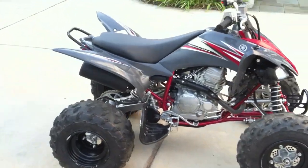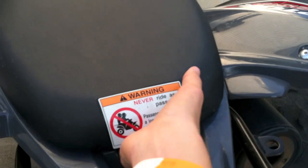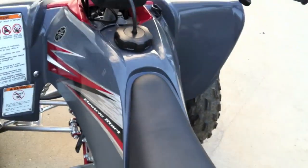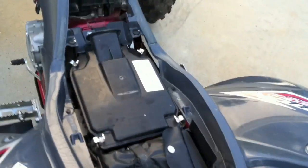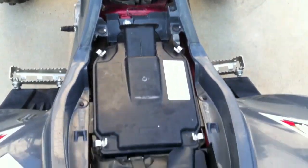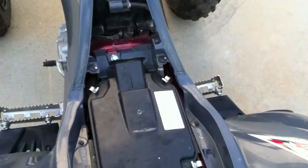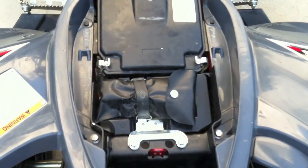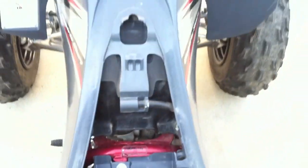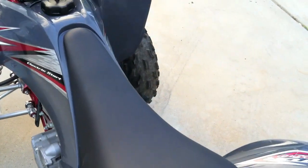Here it is, and it's really user-friendly. I was looking at this right here for the air box — you just reach under here and pop that right up. That was actually pretty dirty under there; it gets really dirty even after a quick ride. I spent some time cleaning it out — I plugged the carburetor and completely pressure washed this whole thing out. As you guys can see, this looks really clean. And then to get the seat back on, you just slide it right forward and pop it right down.